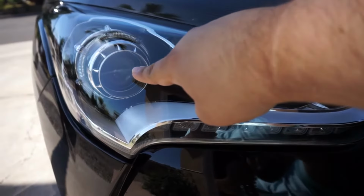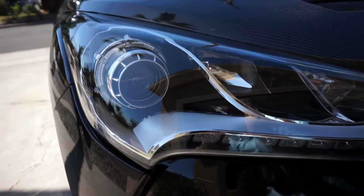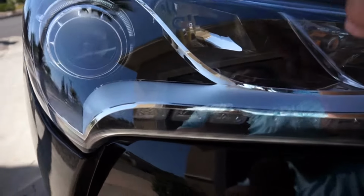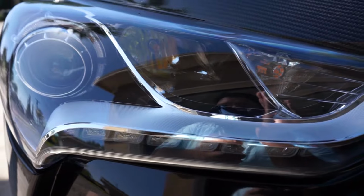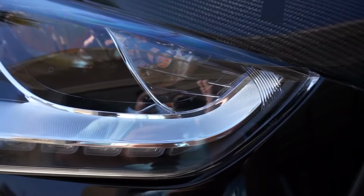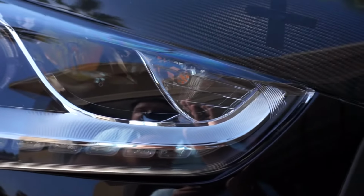First, because we're at the front of the car, I'm going to focus on bulbs. Down the line, I'll make sure to put an image of it. The main headlight bulb for the turbo will be an H11B, very specific, and I'll go over that in a moment. If you have a non-turbo, it'll be an H7. Going towards the inside, the high beam bulb will also be an H7. And finally, for the turn signal, you will have an 1156A for amber, and that's the same bulb for the rear turn signals as well.